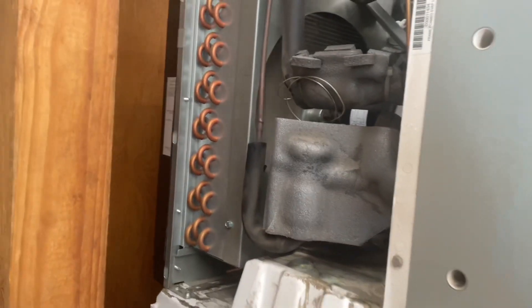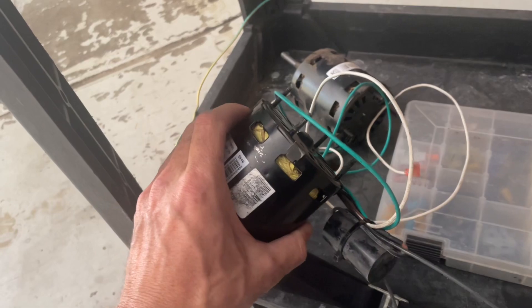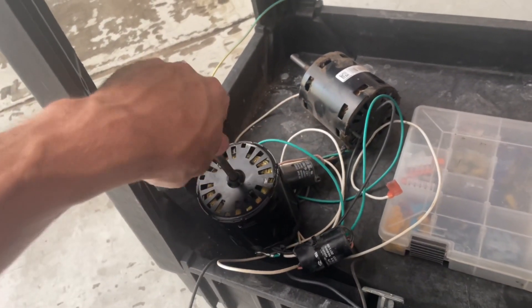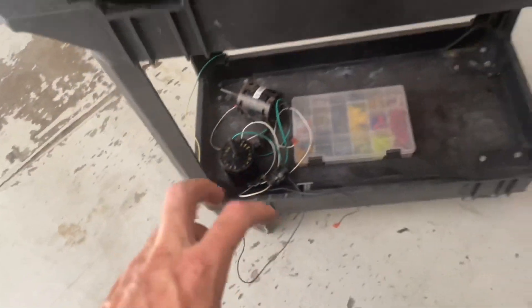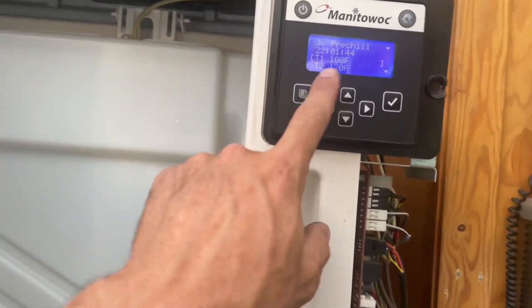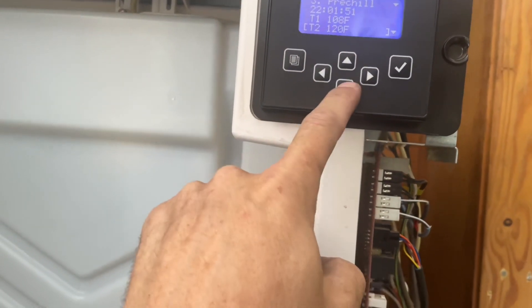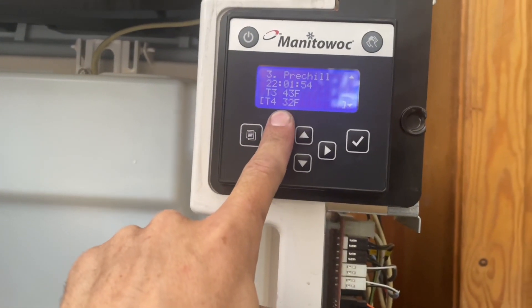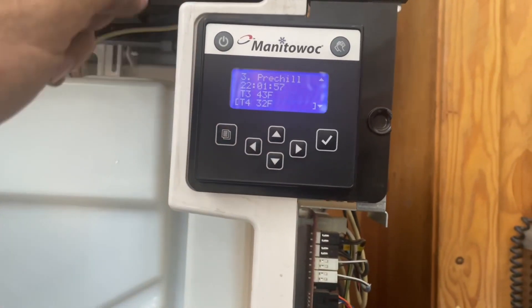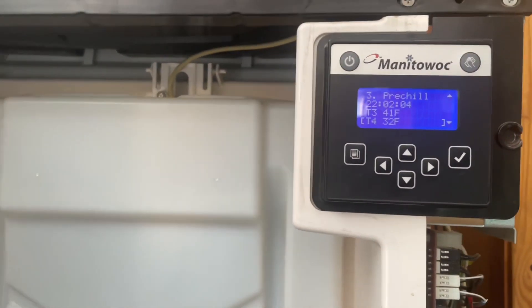See if we make ice. Looks like we are up and running. Fan motor is spinning. I didn't show you before, but this is the motor that I pulled out. This is the used one that I put in, and for whatever reason this one decided it wanted to start working as well. It spins freely, but it just started going and then it stopped and then the same HPCO happened. But now we have condenser inlet temperature of 120, condenser outlet at 108. Our evaporator is pulling down to temp — it started at 70 and it's slowly been going down, eventually around 18 degrees, maybe even lower.